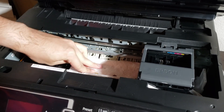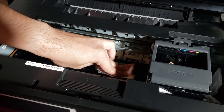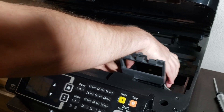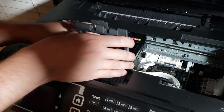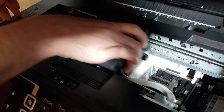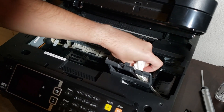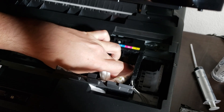It's usually a good idea to have gloves on because it can get a little messy, but it's not a big deal if you get it on your hands — you can wash it out later. I'm now going to get another paper towel to soak up any leftover liquid at the bottom of the printer. You may want to do that a couple of times to ensure there's no liquid remaining, because otherwise it will get stuck to the paper once you start printing. I'm going to move the printer head on top of the paper towel to catch any liquid on the underside, then move it left and right. Just don't push down too hard — you don't want to rub it on the paper towel. Finally, I'm also going to clean the insides of the printer head. Go slowly and make sure no pieces of paper towel clog up the nozzles.